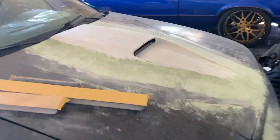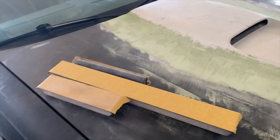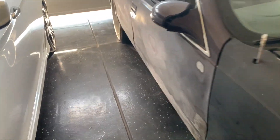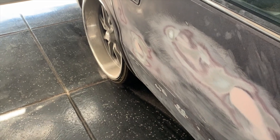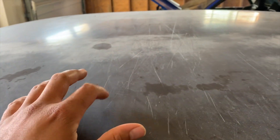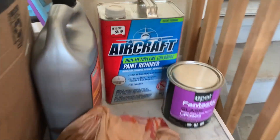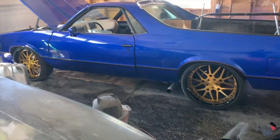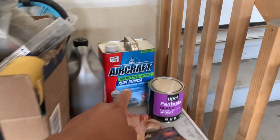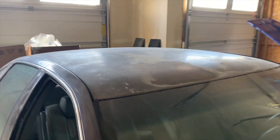I was working on this and I'm going to finish it off and get it nice and smooth — it's not going to be perfect because I still have body filler to do. I got these areas down the side of the car all sanded back down and smoothed out. I sprayed a little bit of guide coat along the side and got all that done. So right now we're going to go ahead and throw the aircraft paint stripper on here — all I've got to do is brush it on and scrape it off.